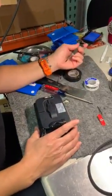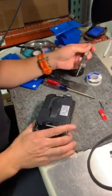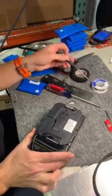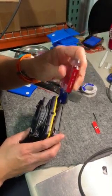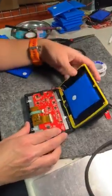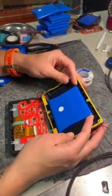To change the battery for a Revolution 5 or a Revolution Pro, there are six screws here you want to unscrew. An easy way to help prop open the case is to take a flathead and twist it in — that will help pop open the two pieces.